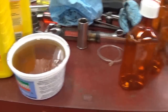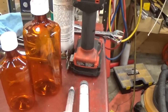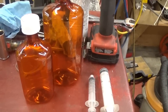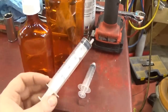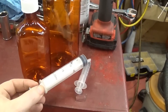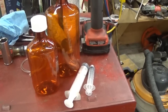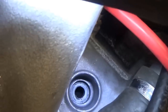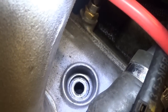To put my oil in, I've gotten some different size syringes from my local pharmacy so the process will go somewhat quickly. For the cylinder at top dead center, I'm going to start with the 20 milliliter syringe — I'll suck up exactly 20 milliliters, squirt it in the spark plug hole, and keep track of how many go in. I've checked that the engine is at TDC on the flywheel, and you can see the piston is pretty close to the bottom of the spark plug hole.